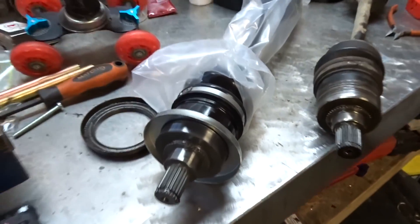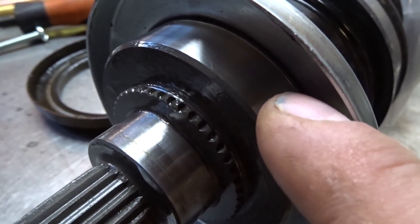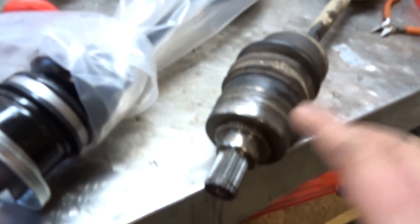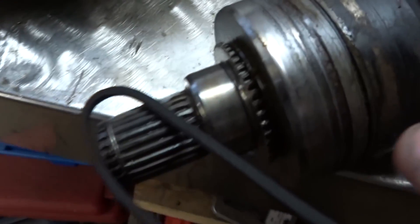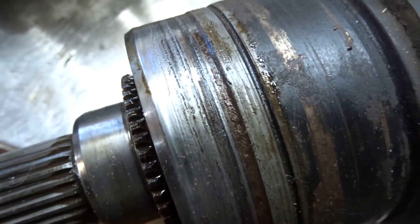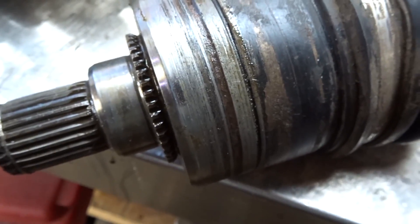This is why we're going to look at the root cause. So this is a new axle right here — your seal surface is gonna ride right there. On the same old axle, the dust shield or mud seal had broke off, and you can see where it was rubbing into the seal itself. If I would have just replaced the seal after the rebuild and put this back in, it wouldn't be long before I'm in the same boat.